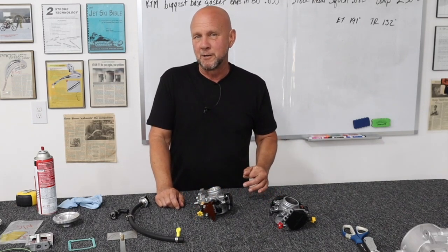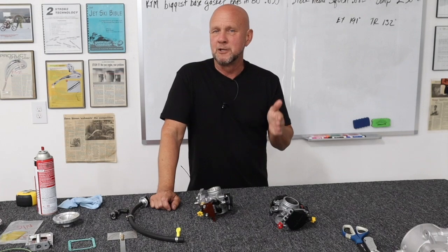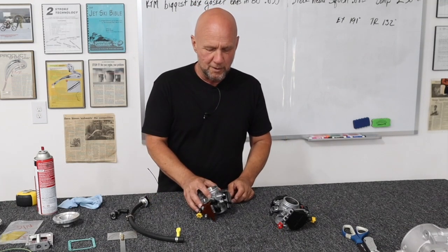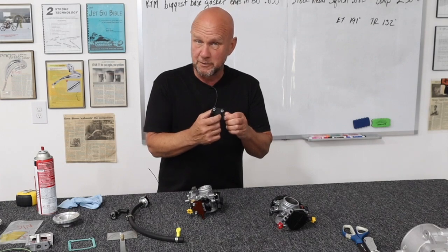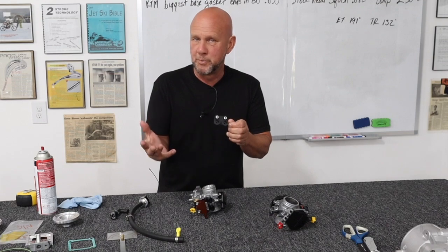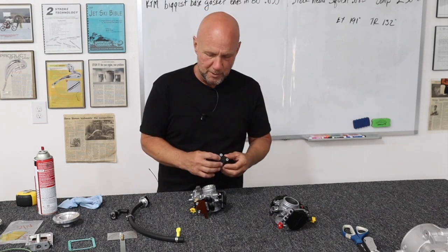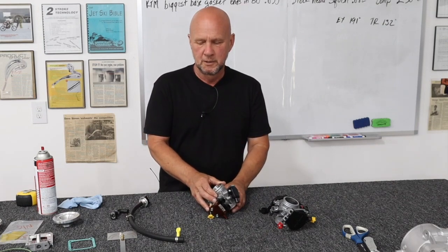Along the way, since I was doing my Bonneville stuff, when I would take my two-stroke and just hold it wide open in sixth gear down the street, you'd get up to about 100 miles an hour but you'd start to see it lean out. Obviously I was running out of fuel somewhere, which ended up being two things. One of the things did end up actually being the passageways in this. Look at the holes here on the stock one, and look at the holes that we drilled in this one — these passage holes are bigger. We made them bigger and solved that problem. For a small price, you get to solve two problems.